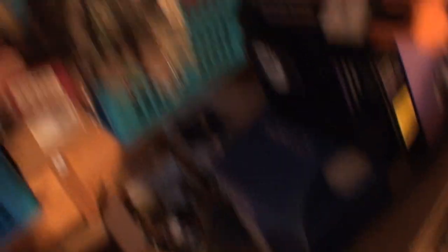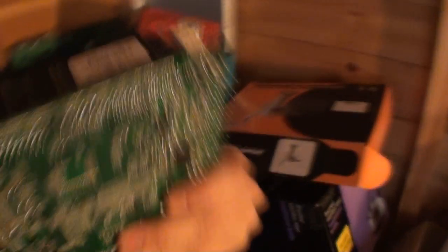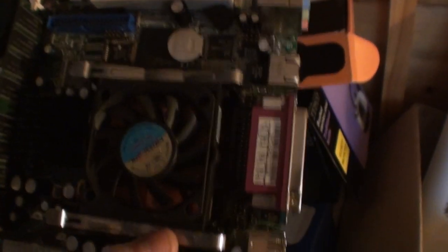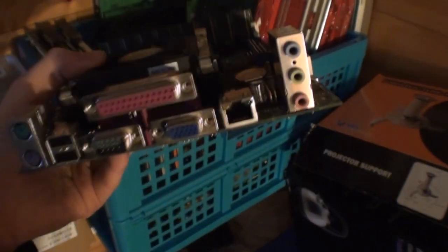This is quite an interesting board I fished out of a box. I believe it's a micro ATX — it's a standard ATX fitting but tiny, with just one single PCI slot. It's got DDR1 PC3200, 512MB. The processor is an AMD Athlon 1800+, so about 1.2 to 1.4GHz — ideal for a NAS. I powered the board up and it works perfectly, so I'll probably put it into use in a project at some point.